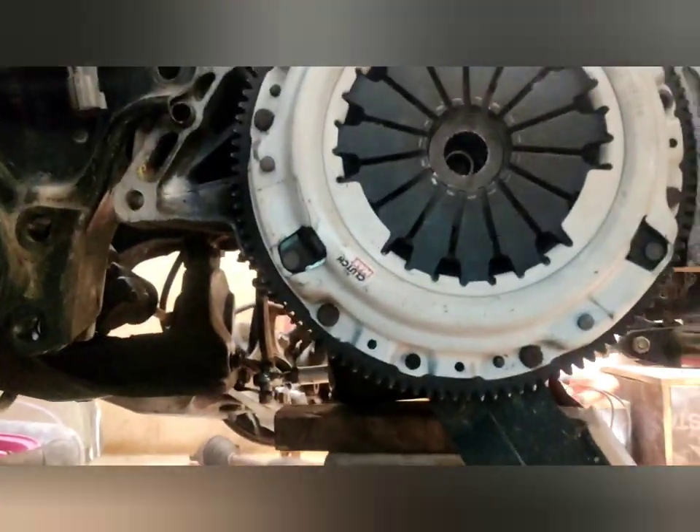Here is the clutch. So what happened: we went to the drag strip. On round one I did my initial burnout around six to seven thousand RPM, and my launch was around seven thousand five hundred RPM with my stage two cams. When I shifted gears, the gears wouldn't go in after the burnout. I did the bleeding of the clutch, adjustment of the pedal — I did everything I was supposed to do on the clutch and transmission, but nothing worked.